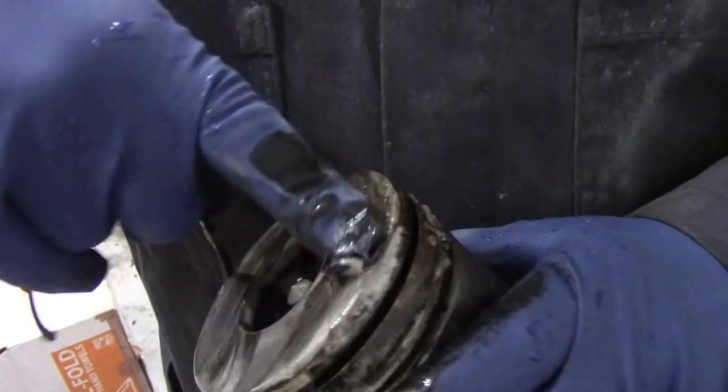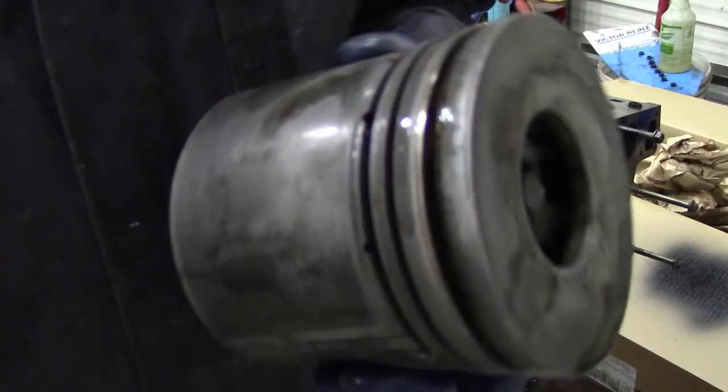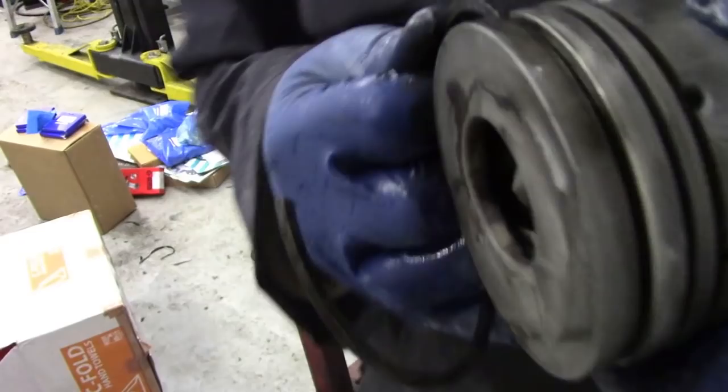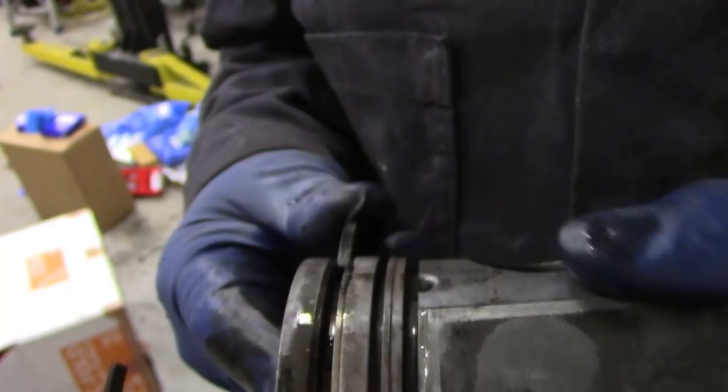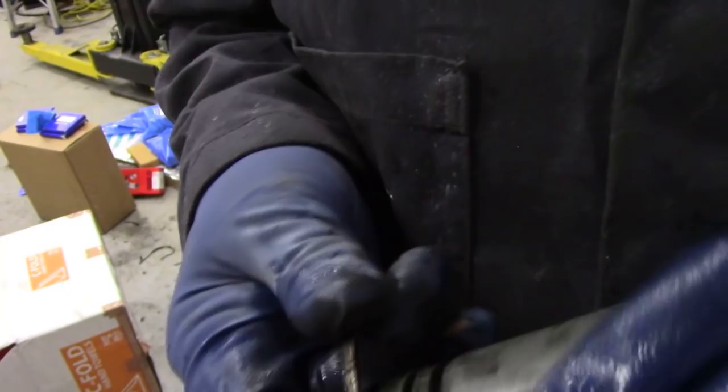It's not nice stuff to use, so just be really careful. I'm going to wash this off - notice the safety equipment. After washing, you can see there are one or two little remaining bits of carbon. All we do is get our piston ring scraper and just push it out - that's all it needs. Those grooves are nice and clean all the way around. You can actually get a dedicated ring groove cleaning tool, but we didn't need it here. You can see the steel insert a little bit clearer now - these pistons are really good and we can use them again.